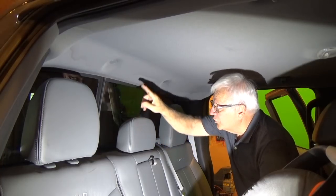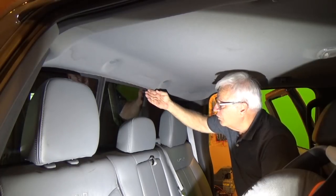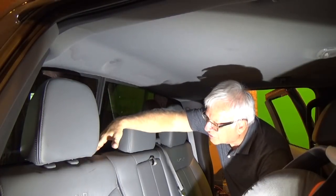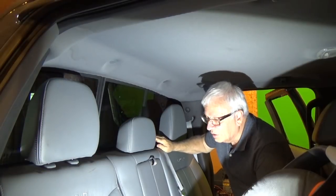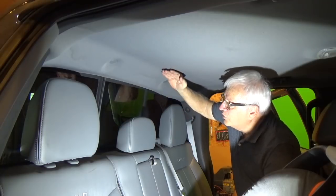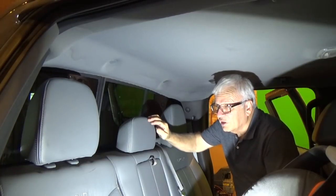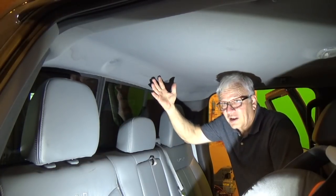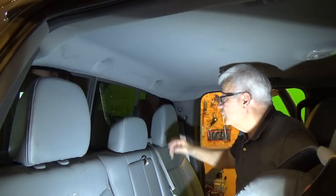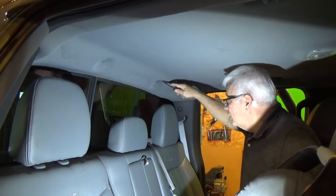As I'm looking at this, I see all my leak water is up here. Gravity will make water flow, so if the water were leaking in around this window seal, I would think I'd have more water stains down in this area, which I don't. Since my stains are up here, the leak must be above this point. So we need to take the headliner down and look. On this case, if my leak's back here, I don't have to take the whole headliner down, probably just the front. There are just two plastic pushpin plugs right here, so we're going to take them out.